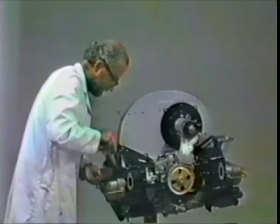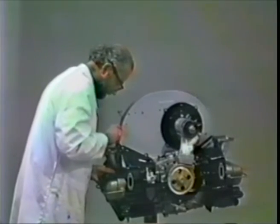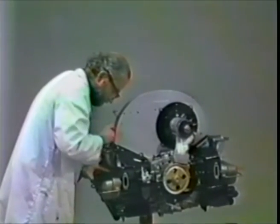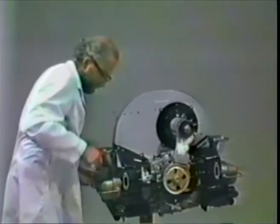And if you're really lucky, it'll work out. Sometimes it may take 10 or 15 minutes to fit all this stuff together, especially if you're doing sheet metal from a random engine. Usually if you use the same sheet metal that came off the engine, it'll go on with a minimum of fuss and bother. But if you're using sheet metal that is random off different year engines, you can have occasional difficulty. So you have to fight it. Once you do succeed, though, it's a great feeling to get that screw home.